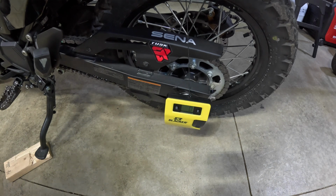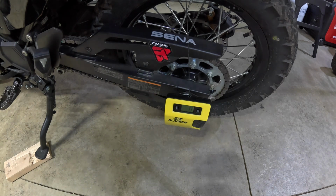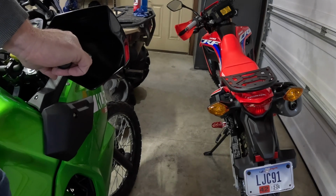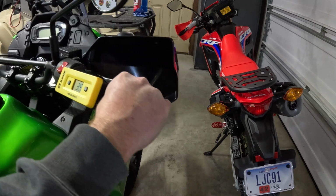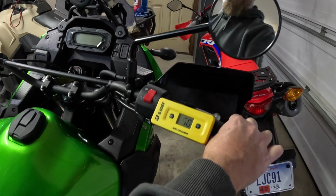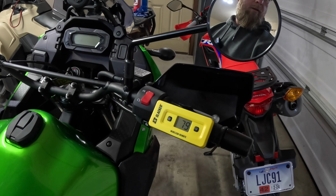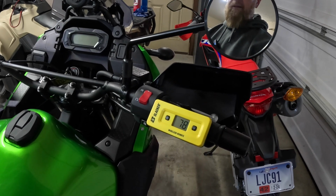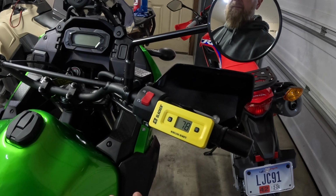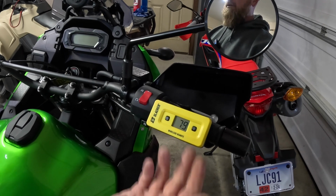So I'm going to change the camera. I'm going to jump on it now, and we'll look at it up here and see how much it sags with my weight on it. All right, guys, let's give it the fat test. So let's see how much sag total with me on the bike here. Make sure the kickstand's off the ground. Give it a couple jumps there, and I'm just dumping my weight on it. And it looks like 78 millimeters total with my weight. My tippy toes are on the ground, but I would say 99% of my weight is on the bike. So that's our total sag.